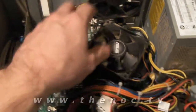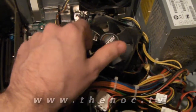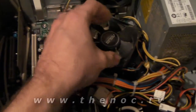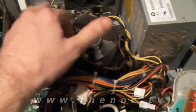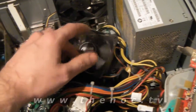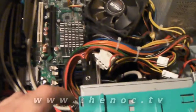So the next time you turn your system on, all of a sudden you've got this clunky grinding noise — no good. The more sensitive ones are going to be the actual processor fans. There's also another possibility: you could actually generate some electricity with these. Think of them as basically motors. With the system off and the fan spinning freely, you're actually causing electricity to be generated in the coil, which shoots back through the system. Instead of the coil generating energy to spin the propeller blades, you're doing the opposite — sending it back through the system.